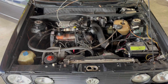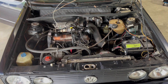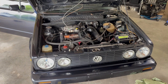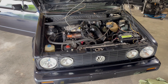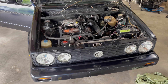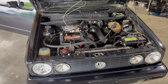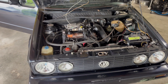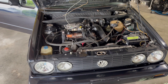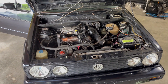I'm going to check the oil levels, check for spark, check clean fuel. We're probably going to have to replace the fuel in this tank because I don't know how long it's been sitting without running. I do know this car was sitting for 10 years, but I don't know if it was parked because it shut down or whether somebody tried to restart it at some point and it just didn't re-fire. I'm not sure, but today's episode we're going to find out. So let me do a bunch of farting around — I'm going to get this airbox back on the car and hook up all this stuff that's undone, and I will check back with you in a few minutes.